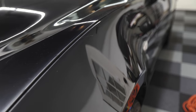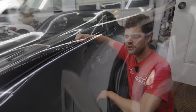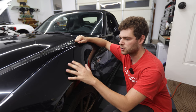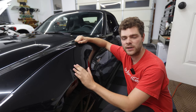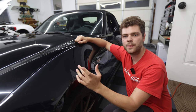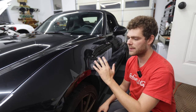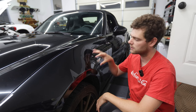At this point I've done the front half of the fender but I've got a few more big dents on the back half to do. I would say these dents are coming about 80 to 85% of the way out doing this quick process. I am not a professional — I'm using a $29 kit from Amazon — and these are the results you could expect picking this up for the first time. I think it's a pretty good improvement for not a lot of time and money.